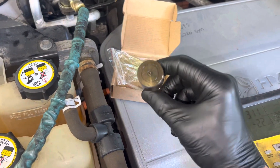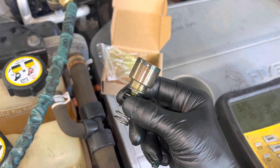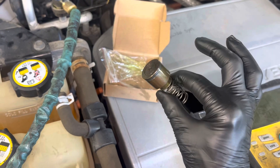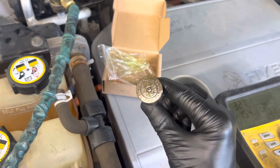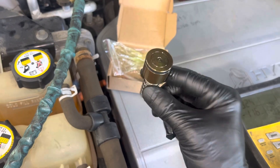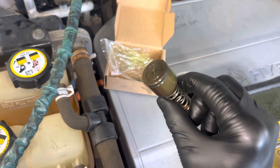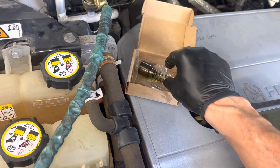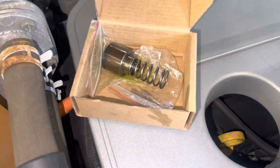If you don't have moisture or oxygen mixed with your refrigerant, you cannot have oxidation. And this shows you — in a hundred years this should be bright and shiny because there would be no contaminants. We have to get rid of shops that screw people's cars up. Alright, see you.